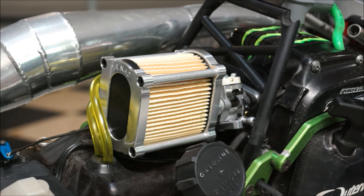That's the installation done with the Senad filter on the Baja 5B. Just a couple of tips: don't oil this filter because if you do it will ruin your filter and most likely your motor — so oil free. Make sure you use the genuine Tecumseh 36905 paper filter unit. And enjoy the life of no more oiling.